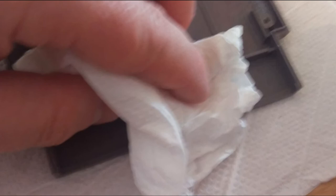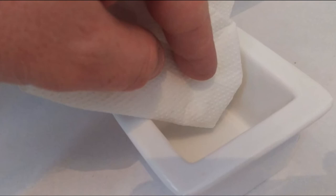Finally we turn back to our isopropyl alcohol again. Get a fresh paper towel, fold it, gently dip it into the alcohol, just dampening it, and now we wipe down the inside of the cart again. And like with the pins before, we'll need to leave time to let it evaporate.